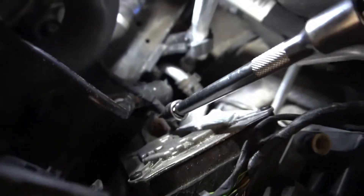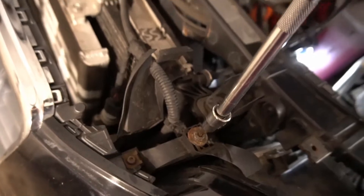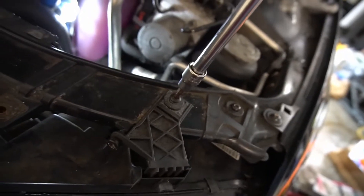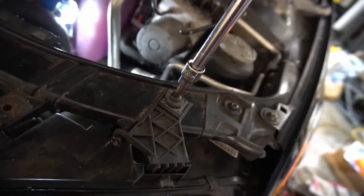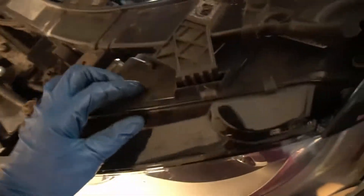Also going to loosen this screw as well. Next, loosen up this screw. This method is also beneficial if you're unable to jack up your car but need to take off the front bumper. Also disconnect the wiring harness for the headlights, and these headlights should pop out easily.